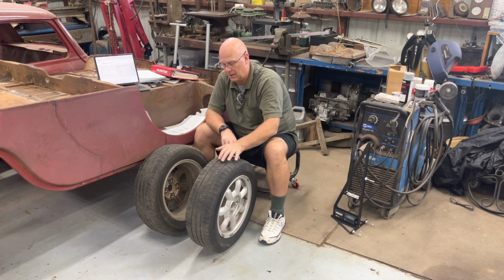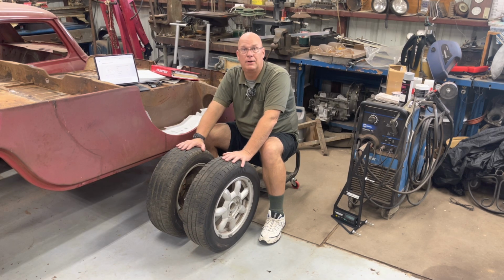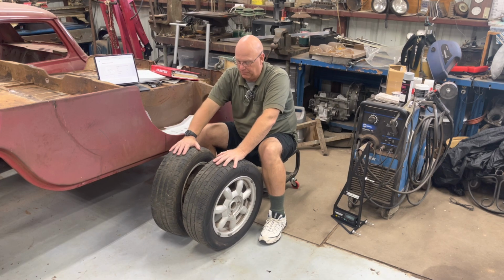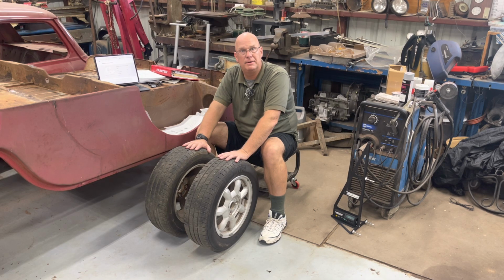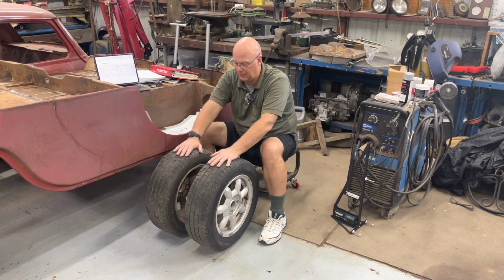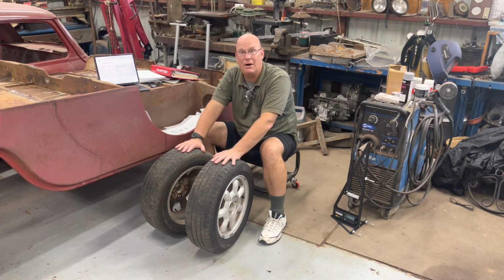Someone figured out, I don't know who, I don't know when, that steering components are better when they are under tension. As in, you're sitting with the 0.35 millimeter sitting still. You start getting the front tires pushed by the back tires, they don't want to go, so they're going to spread out just a little bit. Porsche, I guess, figures a perfectly conditioned steering and suspension system is going to have 0.35 millimeters of slop in it, and it's going to come out that far. So your tires are straight going down the road. Anything less than that, and you're toe out going down the road. Now, I'll come back to that.